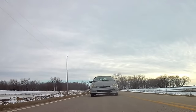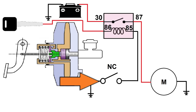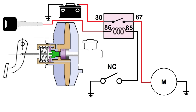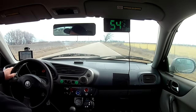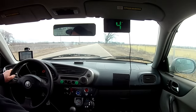On our lightweight project car, power assist brakes are a luxury and we don't need this feature. If the switch or relay fails, that would mean we don't have power assist brakes — as a driver I can deal with that without breaking a sweat. However, on a heavier vehicle there should really be a panic switch of some sort that will bypass all this stuff and provide power to the motor directly. In the event of a failure in the control system, the bypass switch would supply constant power to the motor and restore power assist brakes. The only real issue with running the pump constantly is it'll wear the pump out a lot faster. The road test proved this simple system works, but I don't trust it because of the way the switch and relay chatters.